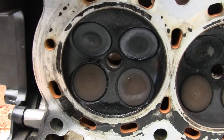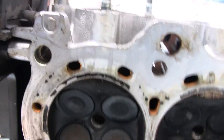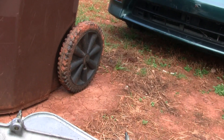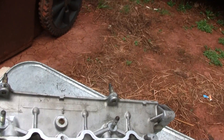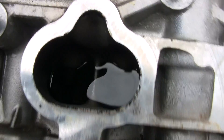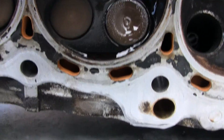I'm gonna show you the difference. It should start leaking right away, or just give it a second or two to eat through the grease and debris. If it's a healthy cylinder, it shouldn't leak. We've filled this chamber up and it's starting to go down a little bit. This one is still full, but you can see that the bent valve one is starting to leak — see how it's running down.